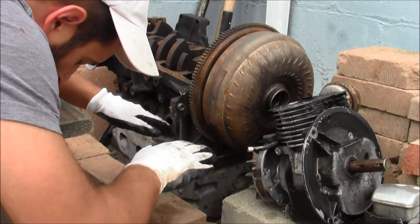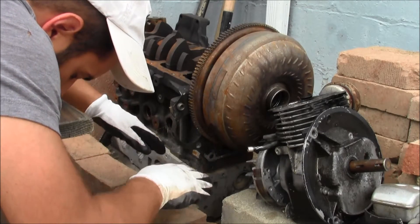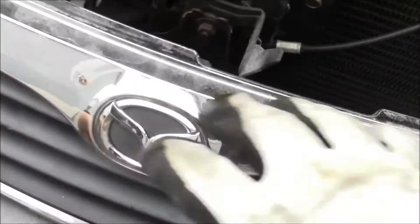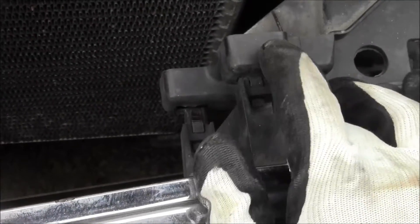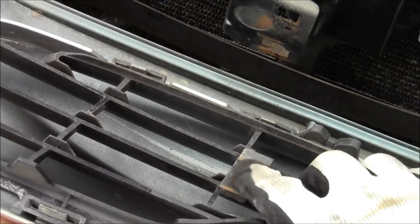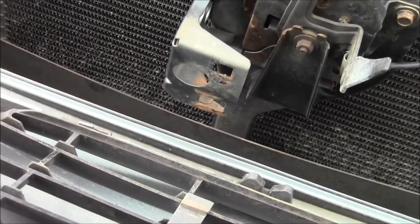Okay, Mazda 626 — this is the front grill. You go up here and press down these tabs, push down each tab, and push down on the tabs over here, and you're able to pull it out. In the middle there's a tab — this one's got a broken piece of plastic that used to fit right here and easily went into this hole.